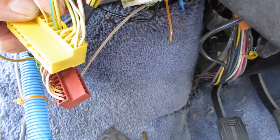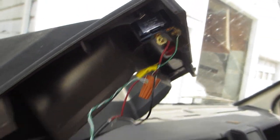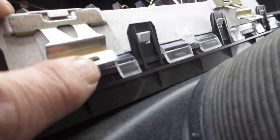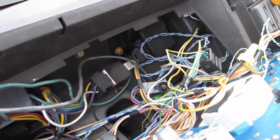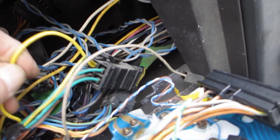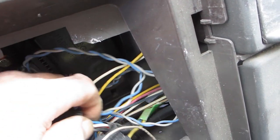So now what I'm going to do is trace these up behind the dashboard and see what happens then. You've got to take your time — and this cover on the dashboard will just pop off, and then you can just press these buttons down here, these clips there, and the speedometer panel and all that will come off. And then you've just got to trace it through, which I just did. And that wire comes to here, I believe. Yes, it comes into there. So I'm going to trace out where it goes from here, see which direction it is.